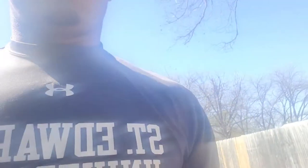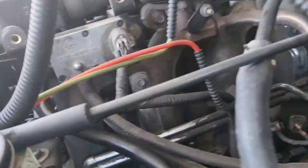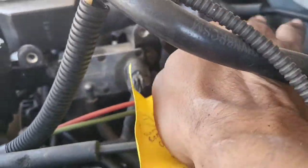Tinkering Tom back again on YouTube. I'm gonna do a motor mount and a transmission mount on a 2000 F-150. Getting some pretty bad vibrations here. I got a list of things I'm gonna remove before I lift the engine. On the bell housing, you're gonna want to take off the EGR valve, because this bracket right here is probably gonna hit the firewall.